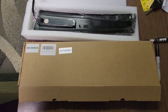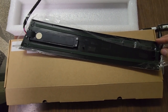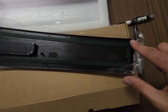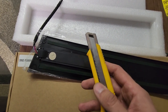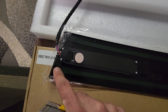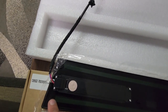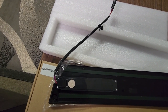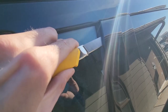Here I've got the one I purchased online. I've never replaced this before, but by the looks of it there are no screws holding it — there are just two black pins and the double-sided tape that goes all around. First I will try to remove the old one. I'll use a scalpel or knife to cut all around. I also believe this bottom piece is tucked in under that rubber piece on the door, so I'll probably have to remove that rubber piece. I might even have to remove the door panel to gain access to the cable connection.